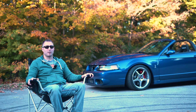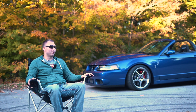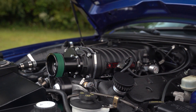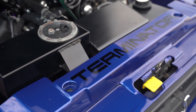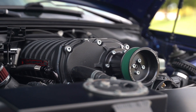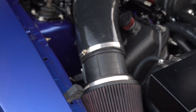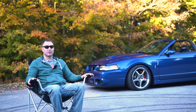To start out with the performance mods, I'm rocking the Whipple Gen 5 3 liter. It is mated to the VMP intercooler core. I do have the one-inch line adapters and three-quarter inch rubber lines going to a 2015 GT500 AFCO heat exchanger. I've got a 2014 intercooler pump. As far as cooling mods, that's pretty much all I've got — the radiator is stock. If you're anything like me and you've struggled with the alternator issues that are common for Cobra owners, I've had a lot of them.